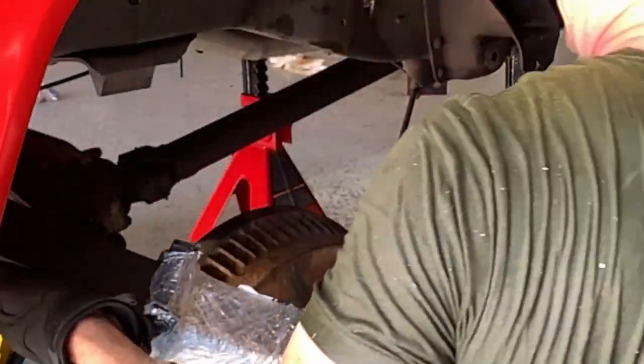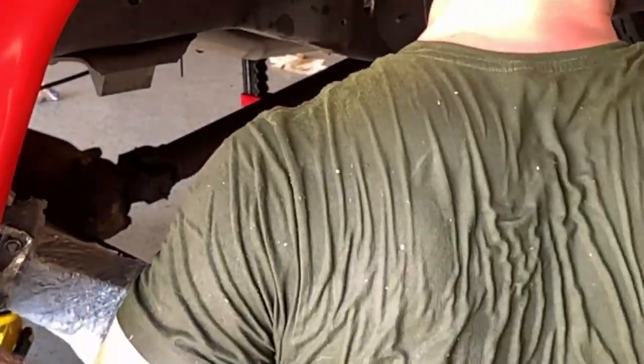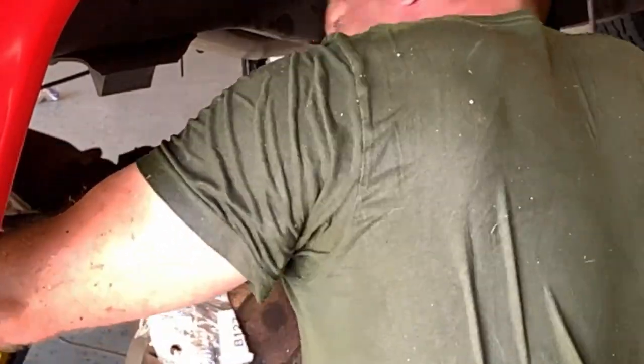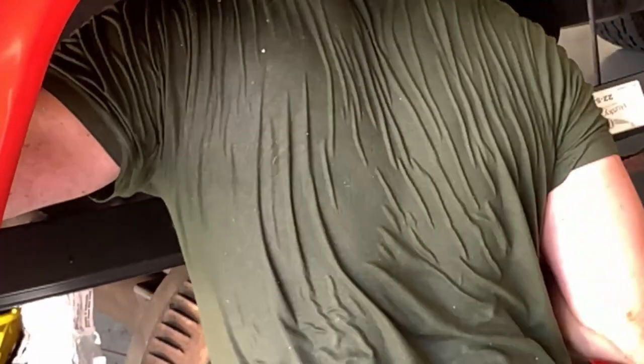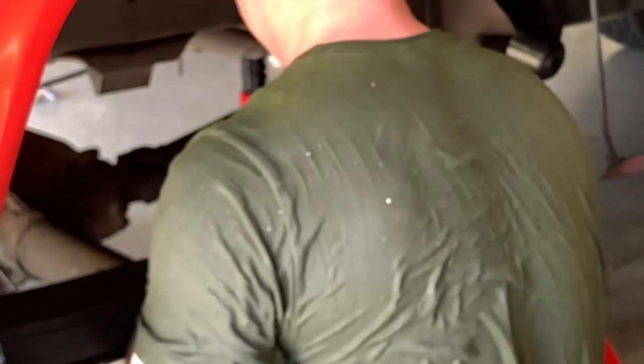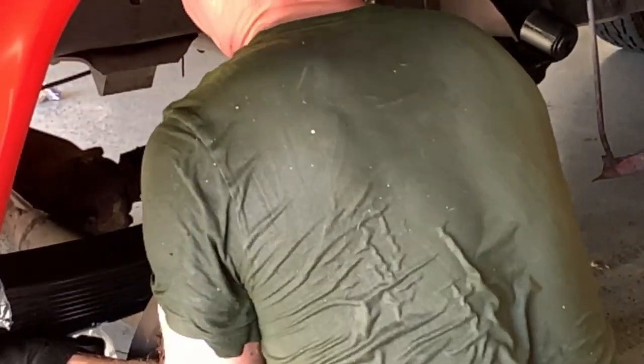You'll place the spring under the truck in the reverse order of how you took it out. First you'll place the tail end of the spring under the truck and slide it all the way back at a 45-degree angle, and then bring the front around being careful of your fender. Once you have the front end of the spring around, you'll just need to heave it up and place it onto the axle, and then do the final touches of trying to get it aligned as best as possible to the mating points.